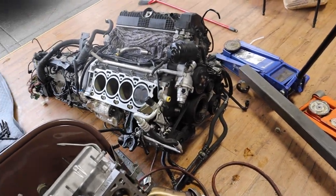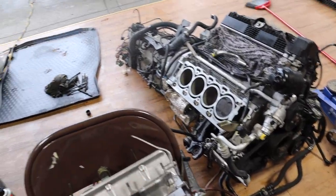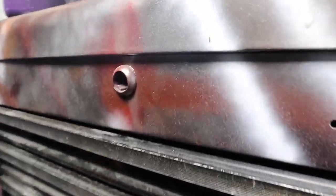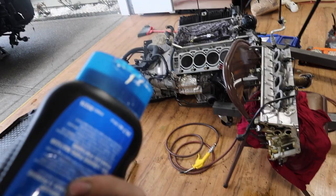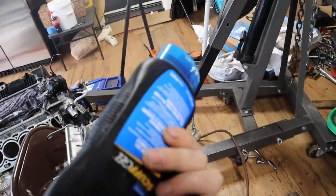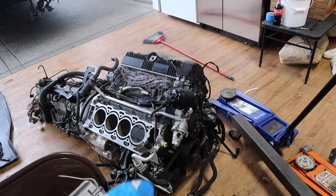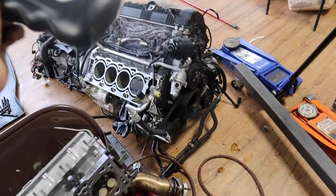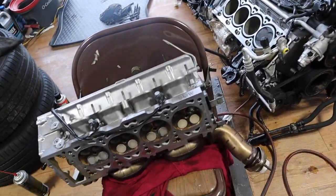So right now I'm gonna find the hose that fits the valve. And I'm gonna put the paste. For the paste, I believe I use this, it's like a scuffing gel. I got it, but well, it works fine. I did it on my E38 engine on the 750iL when I rebuilt it. That's what I did on the valves, and they work fine. So I'll give it a good shake. Anyways, let's go.